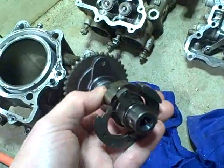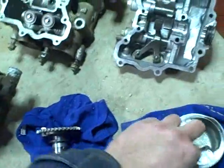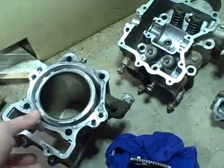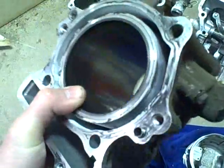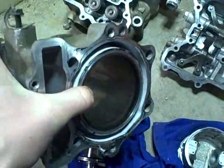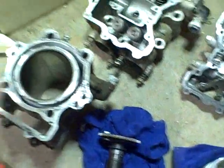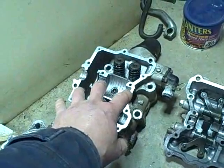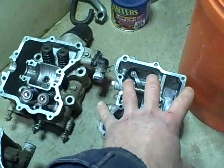So you're looking at a camshaft assembly with the decompression release, a complete piston assembly, and you'd probably have to go with an oversized piston because that seizure left score marks on the cylinder. The cylinder would have to be bored — I doubt those marks could be honed out. So the pretty safe assumption is you have to overbore the cylinder, get a new piston assembly, get a new or good used cylinder head (which isn't the easiest thing to come by), and a valve cover.